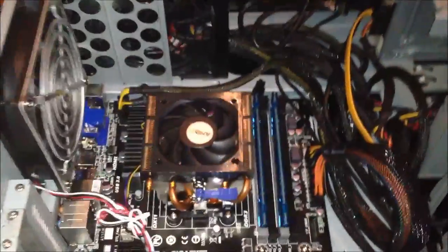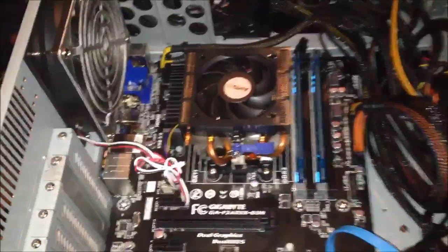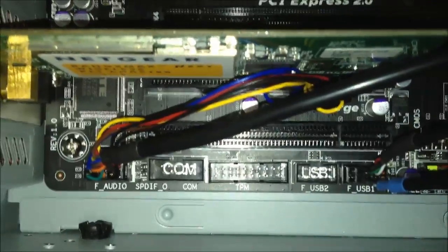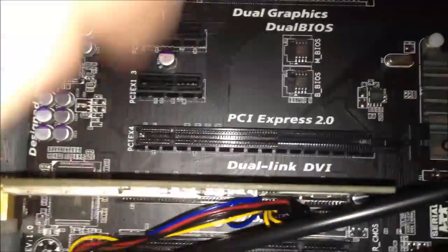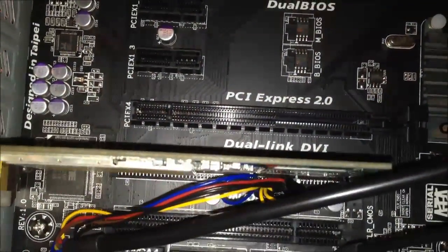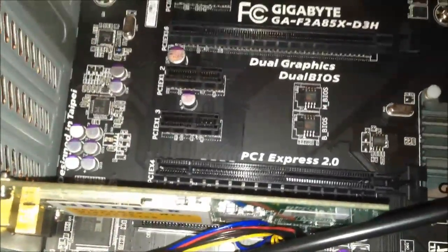So I think it's appropriate to go hook this up and install Windows. Everything is literally on the APU — that'll be interesting. One thing I thought was interesting about this board is it still has a serial header, so you could use a serial port. The lower PCI X16 slot has pins molded for 8X but is only populated for 4X, so it would work for a RAID card or X1 card, but not much else.